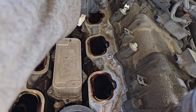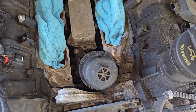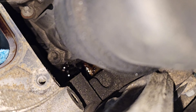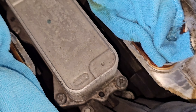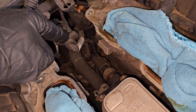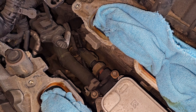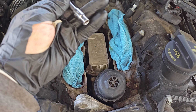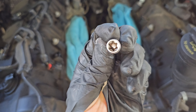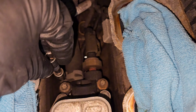Now let's take a vacuum machine and vacuum everything clean, then take some rags and fill those intake ports making sure nothing falls in there. Now you have a way better view on what's going on down here — where it leaks, oil and coolant. Usually the coolant when it starts overflowing flows onto the transmission bell housing and down from there. You also have your notorious oil pressure switch that fails right there, so now is a good time to get that replaced as well. The oil cooler housing itself is held by E8 — I use a skinny one for good access. There is one bolt here, two, three, four and five right here.